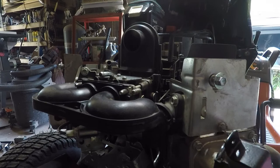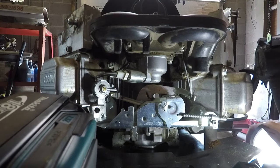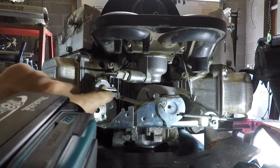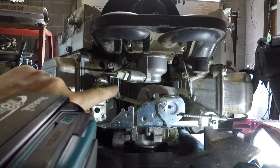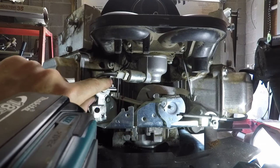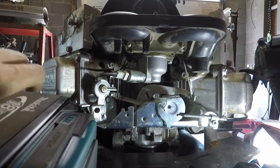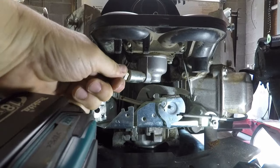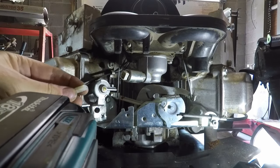There's other linkage at the bottom. This thing's interesting - this must be the automatic choke on this, because this thing isn't attached to the motor or anything. When this must be cold, it must hold this down on this plastic part and pull this down ever so slightly, because right now it's all the way up. I'm just going to unbolt this - it's just the bolt here and then there's a bolt up on top. I've got to pull this out - it just pulls out. There's no keeper you have to press in or anything, just pull it.